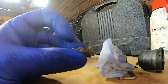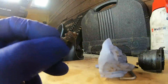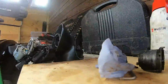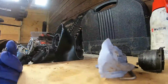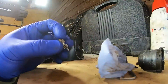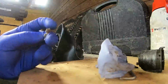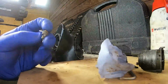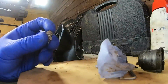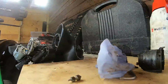It's definitely been chipped through the centre there. Don't know whether you can see it shining. That's got to be from where someone's pushed in the wing mirror without pressing the button, just manually shutting it, which of course it's not designed to do. So I may have to get a little file to all the teeth. If not, then obviously that unit is bust.